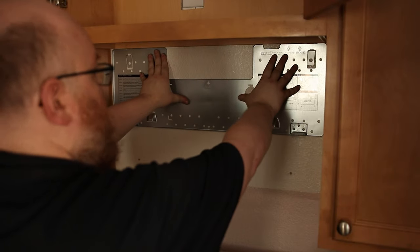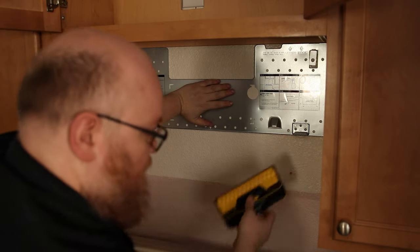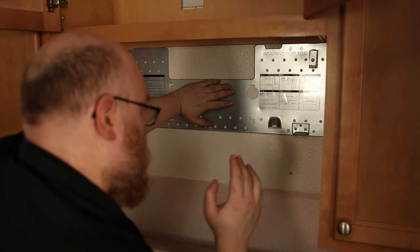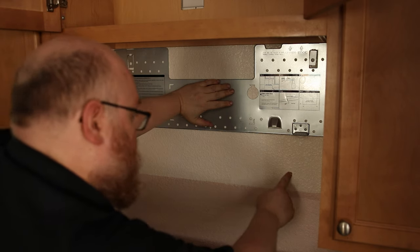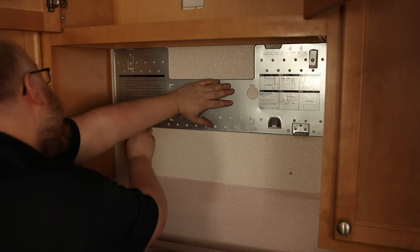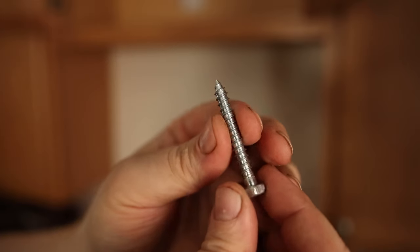My scanner says I have a big 2x4 right there, maybe a 4x4 — either they put a 2x4 facing the wall or there's just a big 4x4 there. I'm not really sure exactly what's going on. I've got a 2x4 there and another big one right there. I'm gonna use these holes as my reference because that's where they hung the last microwave. When you're hanging this, you need to hit at least one stud. You can't just use drywall to hold the microwave, so you gotta find your stud and drill into it and attach it with the lag screw.